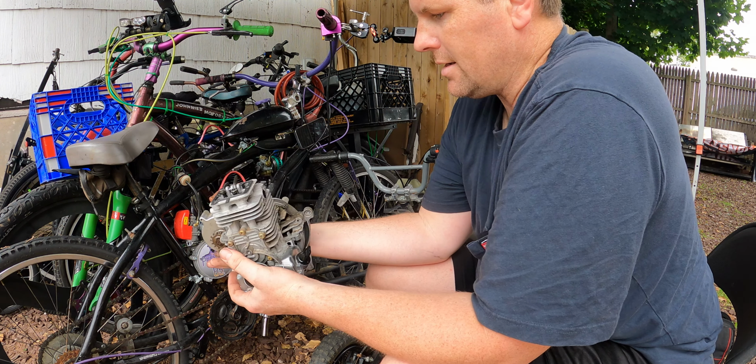All right, we are pretty okay, guys. So this is what we did. We got everything on, we're good to go. Carburetor's on, spark plug's in, exhaust is in. Exhaust also has M8 holes, bolts. I had to drill and tap for M8. Reason being is the casting was horrible. It's like whoever drilled it leaned it this way and this way. It's like the person went in and leaned the drill hard like this. There were threads on top and bottom, but it was ovaled out going this way.